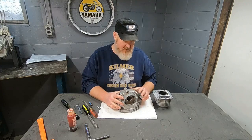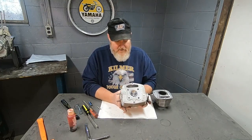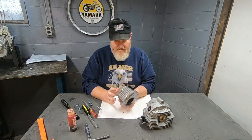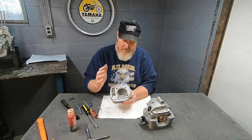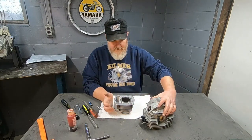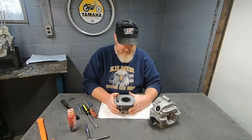Alrighty, so that'll be it for getting the valves cleaned up, valves reinstalled into the cylinder head. It's looking pretty good. I think the bike's going to run very well with the freshening up here of the cylinder head. In the next video, I am going to be working on the cylinder. I'm going to get it honed out. We're then going to get the piston and new rings reinstalled onto the crankcase there and get the cylinder installed along with the camshaft and the cam chain, and then also get the cylinder head on. So we'll see you next time.